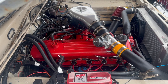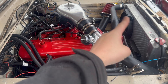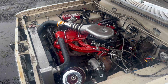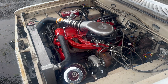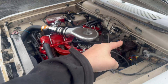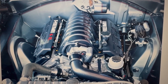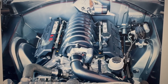This is a great upgrade for any classic Chrysler product, which is why I do it on so many of them, but it becomes absolutely essential if you upgrade your alternator or add extra electrical loads that the factory system was not designed to handle. If you're trying to power EFI and an electric fuel pump and dual electric fans and a big booming stereo and upgraded headlights on your factory electrical system through the factory connections without making this shunt wire modification, you're going to have a bad time.